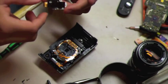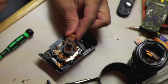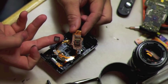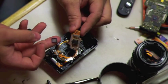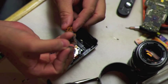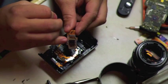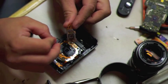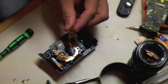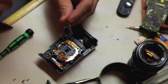Now I'm keeping the sensor pointing down so I don't get too much dust on it. Here's the sensor — I already removed the IR cut filter earlier. Here's the IR cut filter: it's a little tiny glass filter with a little bluish hue to it, and it's stuck on by a little rubber gasket. When it's on the sensor, all you have to do is get your fingernail in between there and gently pry it off. You want to get your finger between the IR cut filter and the anti-alias filter, which is the clear piece of glass still protecting the sensor. You might get a little dust on the sensor, but since it's protected by that anti-alias filter, you can just use a nice quality microfiber towel and gently wipe it off. Be careful not to touch any of the leaves on the thing.